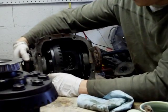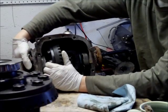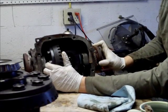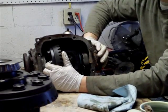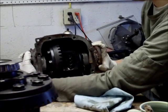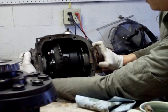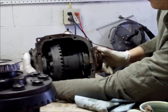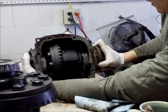If we introduce some torque and fight the two rear wheels, one wheel will actually stay stationary while the other one receives all the torque. Right now, since they're spinning opposite directions, they're actually splitting it evenly — 50% to each wheel going one direction, 50% going the opposite direction. If I was actually strong enough to hold this in place, you'd see that the ring gear is still moving, and I'm holding this side still while the other side actually spins freely.